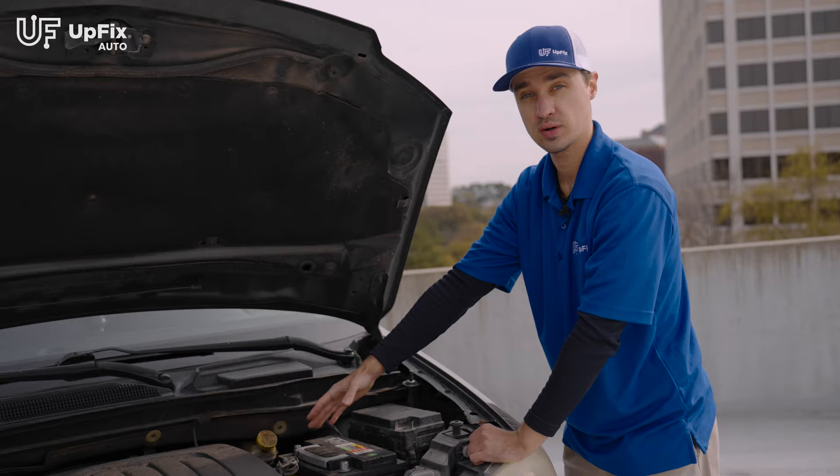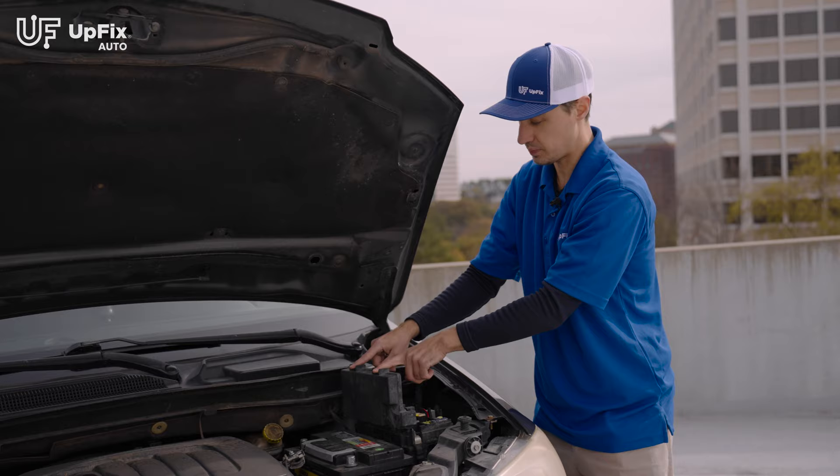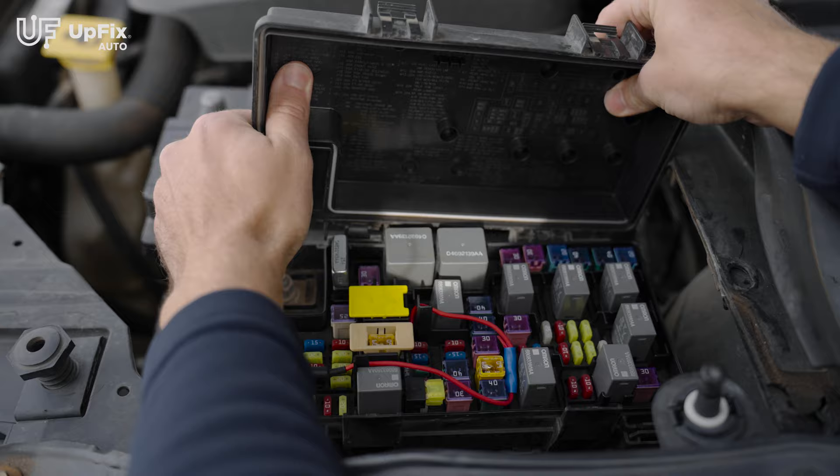While we have the battery terminals doing a hard battery reset, in the meantime we're going to remove the TIPM. You may or may not have a plastic cover over this — it just removes like so when you depress these two levers right here, and the cover can pop right off. This is the TIPM unit itself.